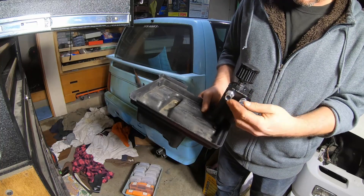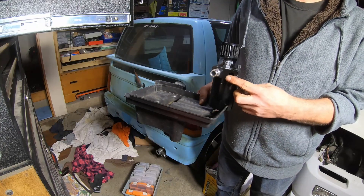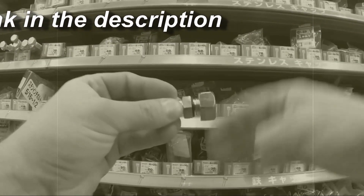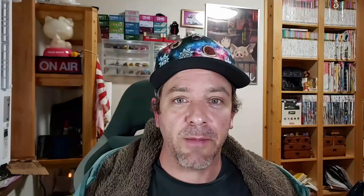Now I need to get rid of this unused port. I had an idea - this is M16, 1.5 pitch. I can screw that all the way on. I just need an M16 1.5 pitch bolt that's really short and then we'll be good. You might be thinking that's really elaborate and dangerous - elaborate yes, dangerous no. The vice grips were never going to let go of that bolt and the vice was never going to let go of the vice grips. I was standing in that position to use the grinder because the grinder would hit the vice from the other angle, and I didn't want to flick sparks onto the cars.